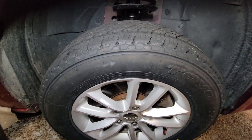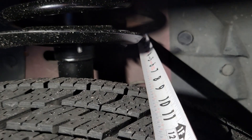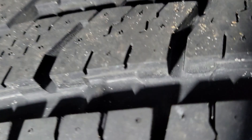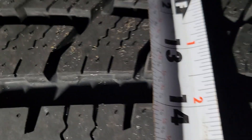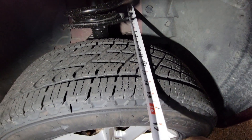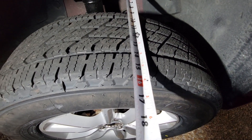Let me get a tape measure. I've got the tape measure up against the inner fender well and we're going to look right here at the edge of the tread — call that 13 and a half inches. Now I'll push the tire in and that's 12 and 7 eighths. So that's five eighths of an inch difference just by loosening those two bolts.